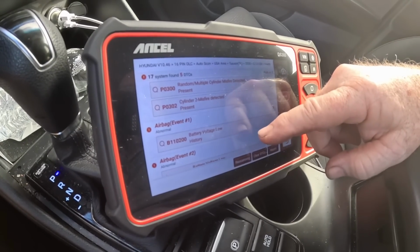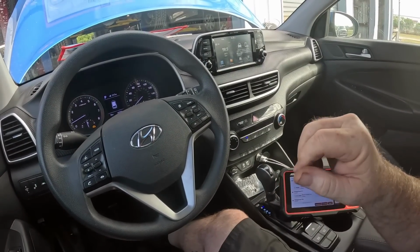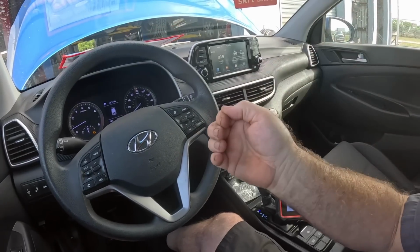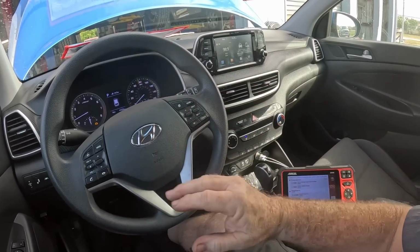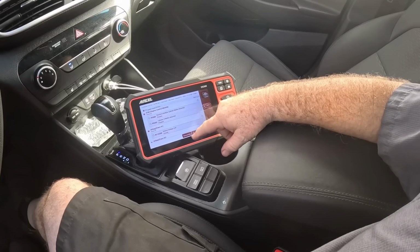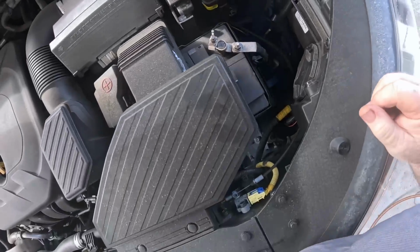So we take a good look at the battery, which you always should check when you do any kind of diagnosis work. Battery's got to be in good shape. You can get all kinds of weird codes if a battery's getting pretty weak, because when it cranks it'll dip even lower, and then it'll set weird codes because the computer gets very confused. So let's take a look at the cylinder 2 coil, if it's easy to pop out, and take a look at that battery. Uh-oh, got a Die Hard.